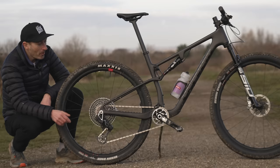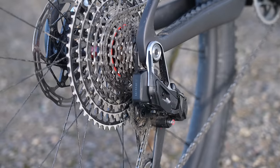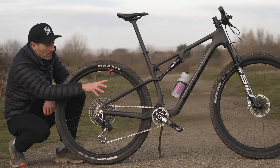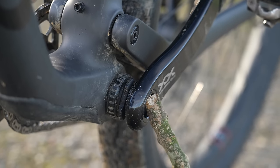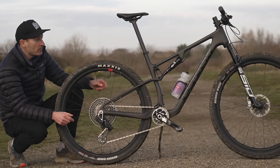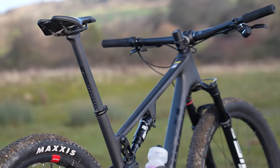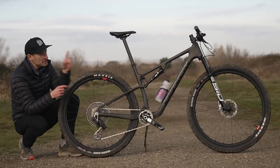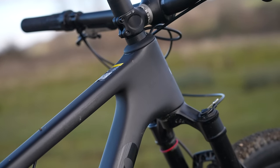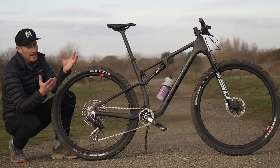There are some nice details on the bike that really stand out. For a start, it's SRAM UDH compatible, so it takes their newest groupset. We have a nice chain retention device for the one-by setup, a threaded bottom bracket, space in the main frame for two water bottles, clearance for 2.4 inch wide tires, and you can fit a dropper seat post. On the downside, we have internal routing for both the rear brake hose and the cable for the rear shock lockout, so perhaps a small thumb down for that - but that's the way many bikes are going.